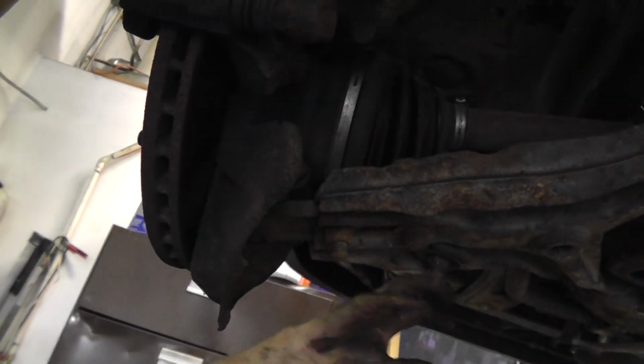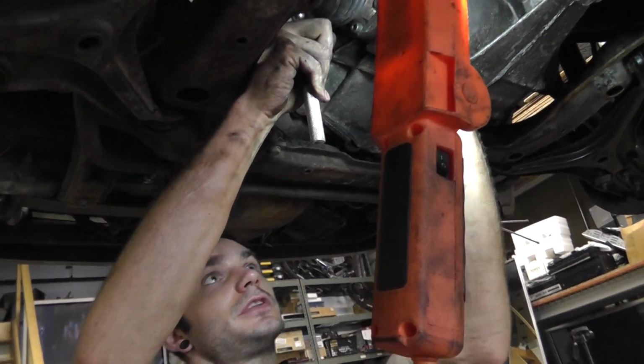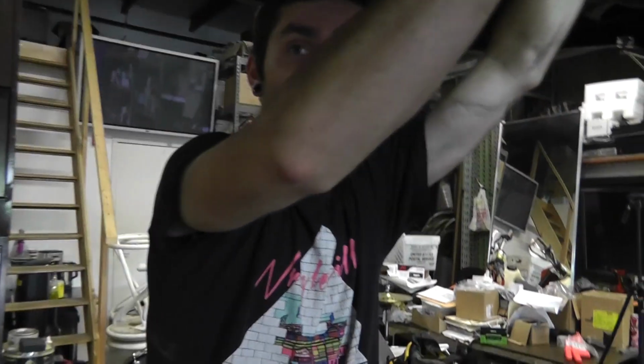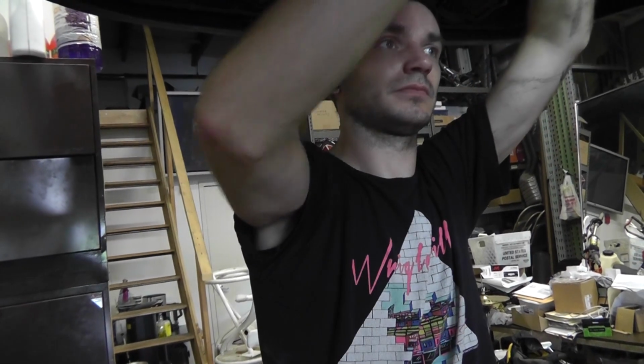On Japanese cars, you have to get it off from this side, take the control arm off so you can get it out, and pull it out of the transmission. It's just sitting inside. It's not screwed in. Because this is screwed onto a cap. You see this part? This is what spins. It's screwed onto here. But in a Japanese car, the axle goes right into the transmission. It doesn't have this connection point over here, so you cannot take them off. Why wouldn't you have it screwed on? Fewer parts. Why would they produce more parts?